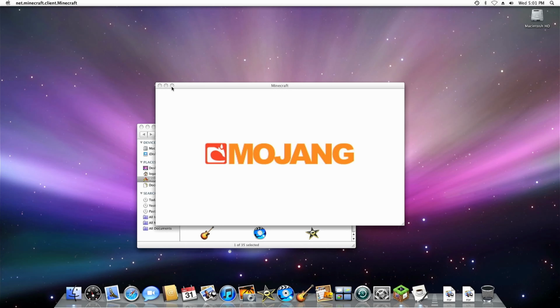I bought this one in, quote, tested working condition, and when I hooked it up for the first time, it did actually power on, but it refused to boot into any sort of macOS installer that I tried to put in. The computer would just hang at this screen with the gray Apple logo, and the fans would slowly ramp up until they hit full blast.